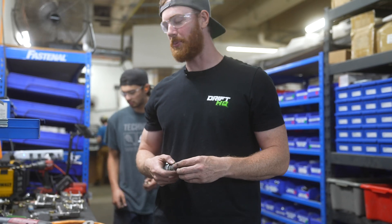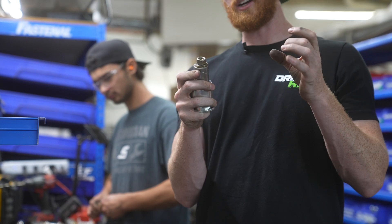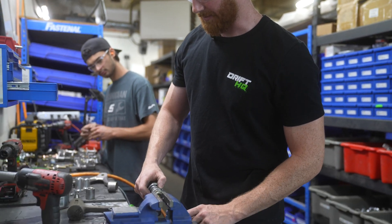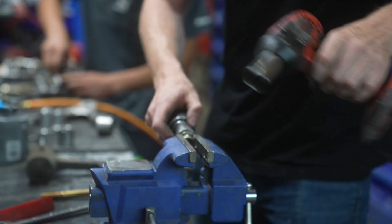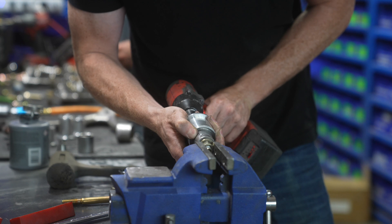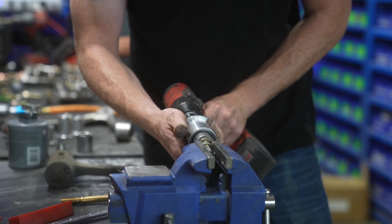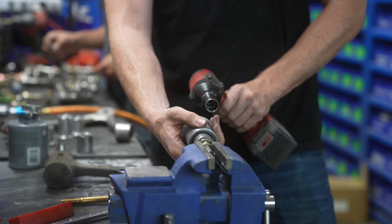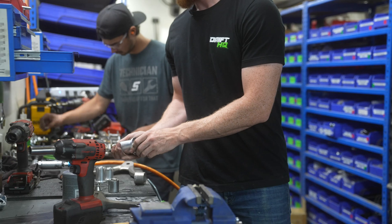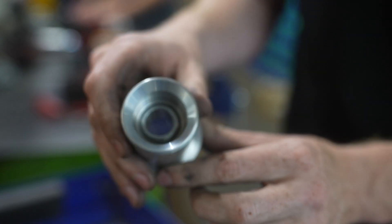For the purpose of assembling a couple things, I'm setting up a bearing presser - basically a washer on this side, a socket that's the same diameter as the bearing - and I'm going to suck them together. For mass assembling we wouldn't do it this way, we'd have a different setup, but essentially I should be able to just pull them together nice and slow, nice and steady.